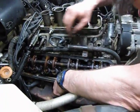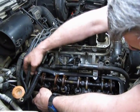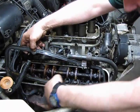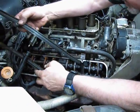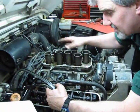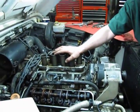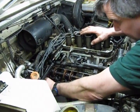And here's your gasket. And again, keep tabs, look for those little four barrels. Should be one in each hole. If you see one missing, make sure you look carefully inside the head and on the base. When we pulled the other side, we actually found a spare barrel down in there left by the last person that put the valve cover gaskets on.